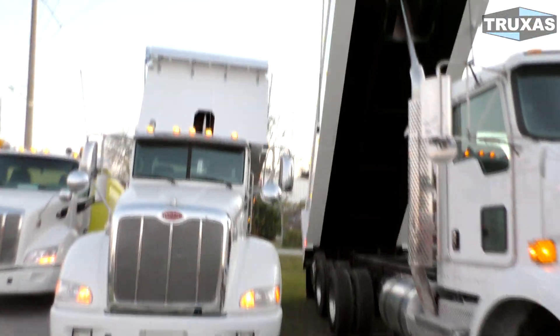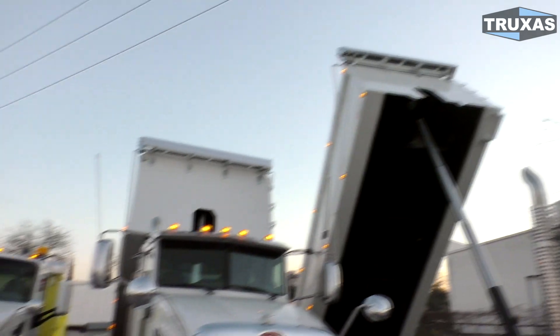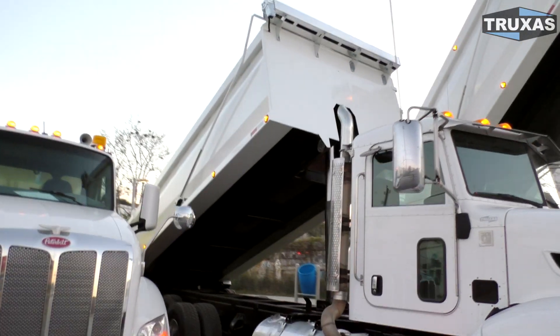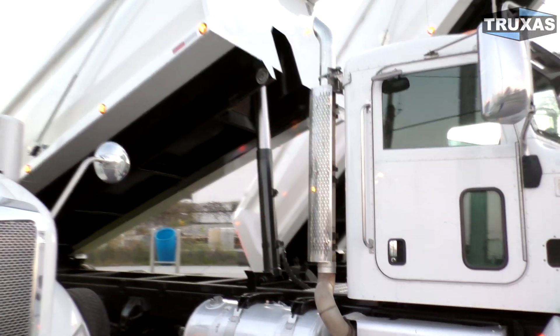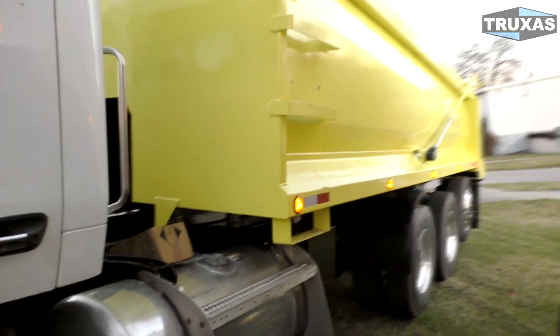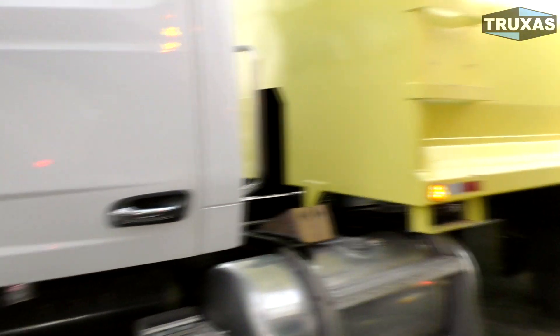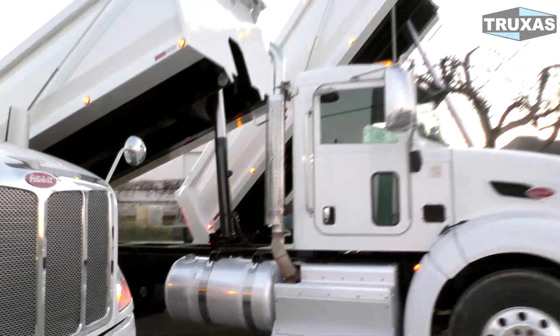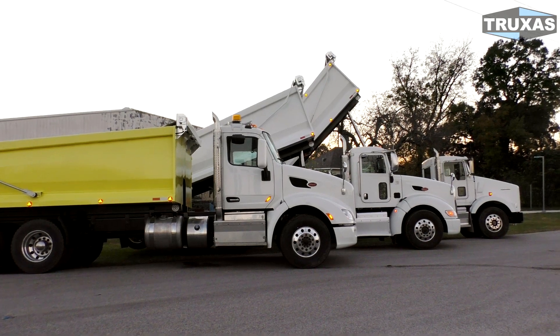On these we also did the inside hoist, so if you can see the hoist is inside the bed. That's less expensive and you don't need it on the outside to get the maximum amount of weight in the front. Because with this smaller gap between the bed and the cab, it makes it easier to get the weight on the front axle, and having that big block engine here helps you get the weight up front as well. So no lack of getting weight on the front with these, whereas on the other ones it's very difficult to get the weight in the front, so you can have a more balanced load in the dump body.